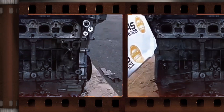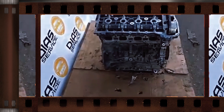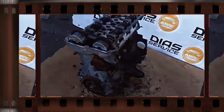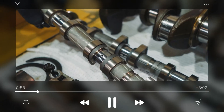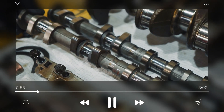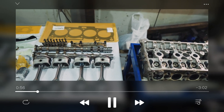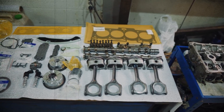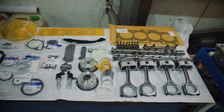The thermostat is a steel unit rather than aluminum. The ignition coils are specific to this engine, and multiple smaller changes were introduced. While some G4KD parts can fit with modifications, many components are not directly interchangeable, because Mitsubishi employed higher grade materials and altered certain dimensions.